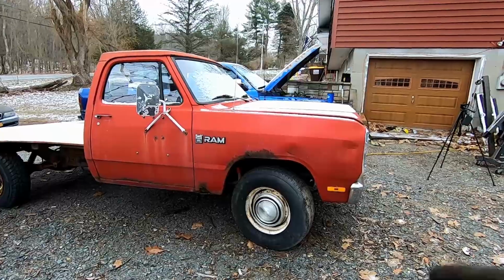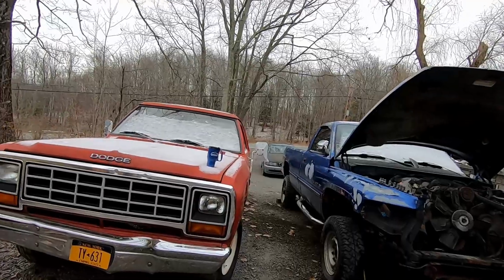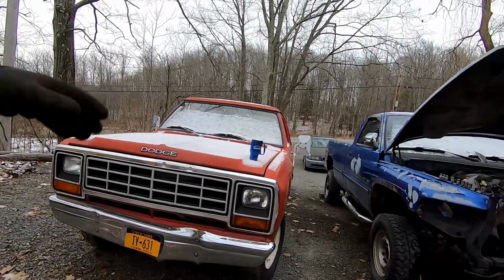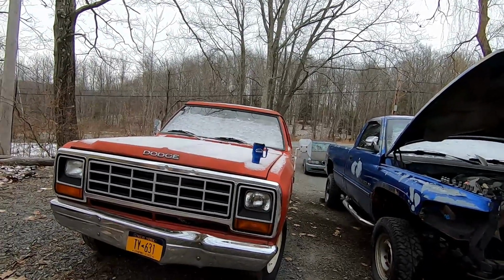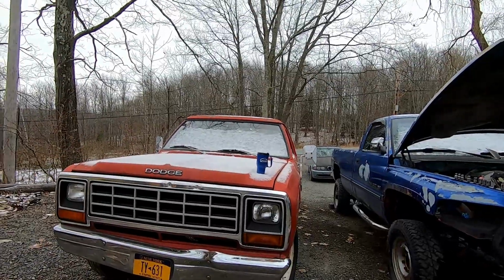We had an Edelbrock carburetor on it, Edelbrock single plane intake. The thing was really just terrible on gas because, you know, I never really built something as a truck, so I was going in the mentality of a car. And don't do that with trucks, not if you want gas mileage. So I did everything I would do on a small block, you know, single plane intake, big carburetor. The thing was a freaking monster. Do burnouts all the time. Just even trying to nurse the thing was pretty rough.